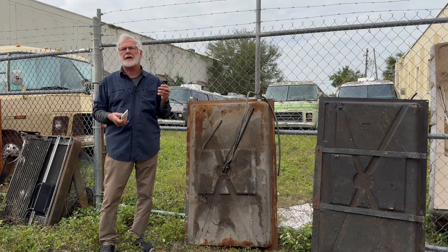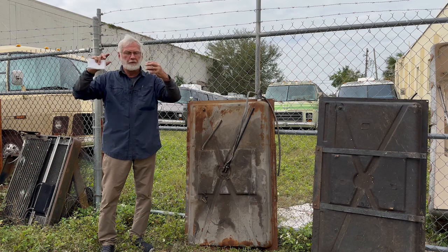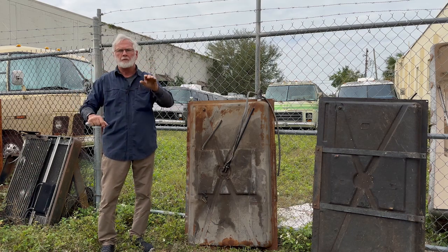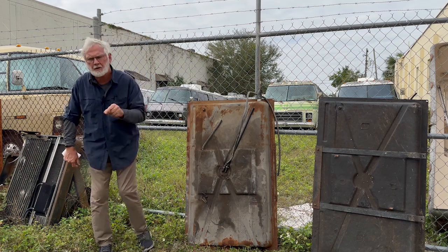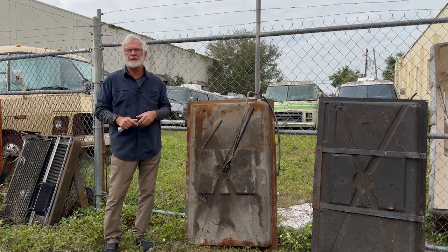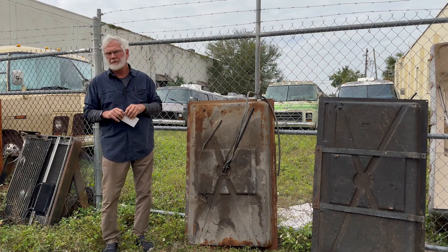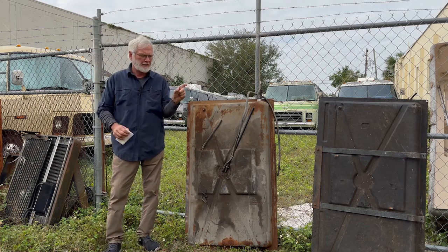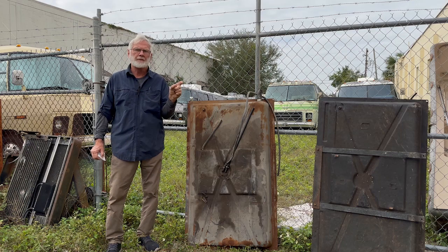If you can find a stainless steel cleanable, clear filter, so you can see flow, 10 microns or smaller, you've got to put that in the system. And you've got to be able to clean it, because we know that we're going to create junk. Yeah, it's going to do it. All right. Next thing, if you're going to run a carburetor, there's a 330-48 little 5 micron paper carb filter in the front of your carburetor. Have a bunch of them.